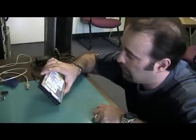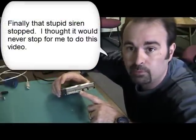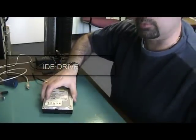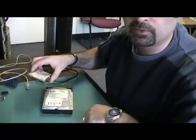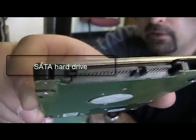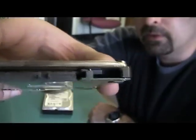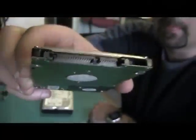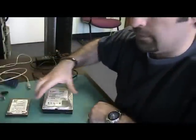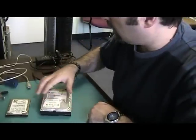Depending on the type of hard drive: if it's an IDE hard drive, it'll look like this with pins on it — you can get a closer look here, this one has pins. Whereas some of the other ones — now this is a laptop hard drive, so it's much smaller in comparison. It has something other than pins; it's a little harder to see, but if I tilt it at the right angle you can kind of see it's like a ribbon. This is called a SATA hard drive, or SATA — the other is IDE, which has pins.